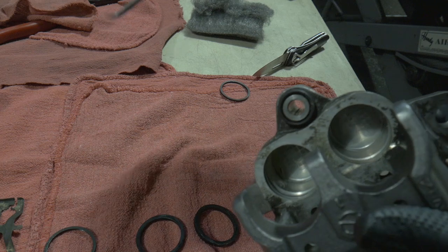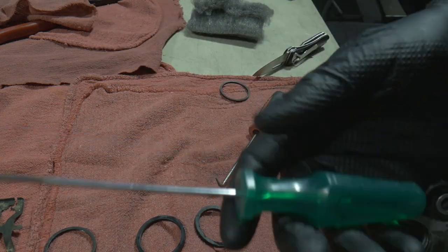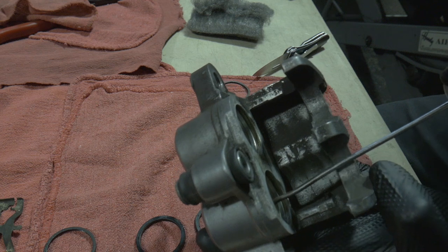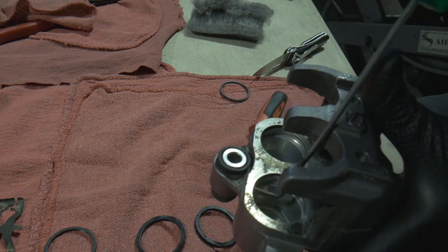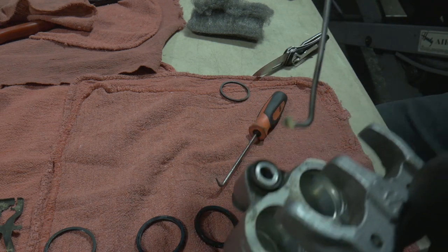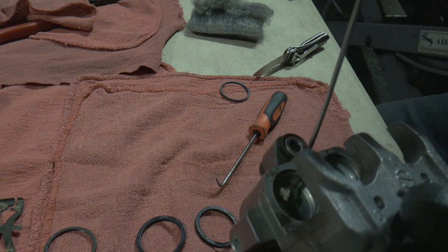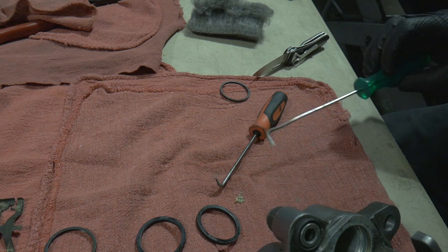Some calipers are really, really bad; on older bikes some are not so bad, just a little buildup. I took a really cheap flathead screwdriver and bent the end of it so I can get a little angle and get right up on the corners to get that crust out of there. I'm not using a lot of pressure, just scraping very easily all around — and you can work down inside here. There was some right there building up just behind the piston, which probably wouldn't allow it to go all the way back. That's where you're going to spend all of your time.